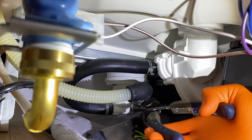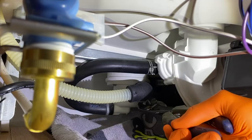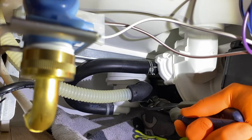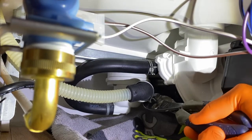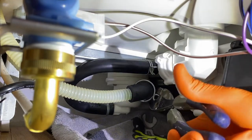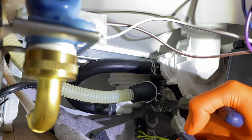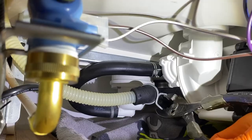As I compress this, I'm going to shift it off or rearward. Just be careful — you may have to kind of jiggle it and turn it left and right, and just carefully shift this rearward. Don't tug too much because you don't want the hose coming off yet. As you can see, it's coming off and you just want it rearward to the point when you release it, it's not going to grab on the inner plastic of the housing where the impeller is.